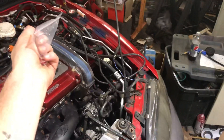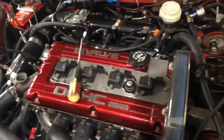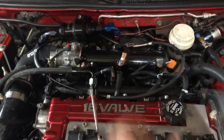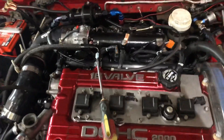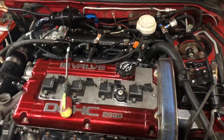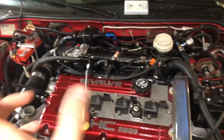I cut the MDP wire and put bullet connectors on both the MDP sensor and the new harness. The new harness is black, red, and blue — black is ground, red is power, blue is data. I made a one-foot extension harness using bullet connectors because it lets me swap that same 0-to-100 PSI sensor for oil pressure or any liquid pressure measurement. Since you're limited on inputs with ECM Link, this lets me swap the sensor to another location just by swapping the patch harnesses.